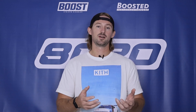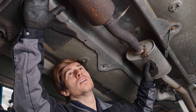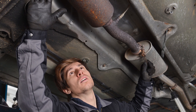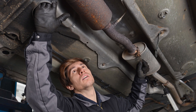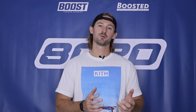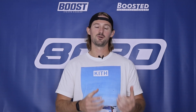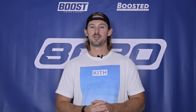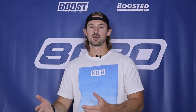If there are no issues with the wiring and everything on the oxygen sensor looks fine, check for exhaust leaks. The best way to do this is to get underneath your car with the engine running and feel around the exhaust to see if air is coming out where it shouldn't be. Do not touch the exhaust directly since it's very hot — it's best to do this on a cold start so it hasn't fully heated up yet. Focus around where pipes connect, as that's most likely where a leak will be.